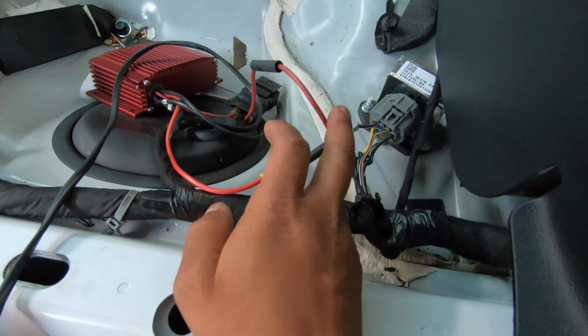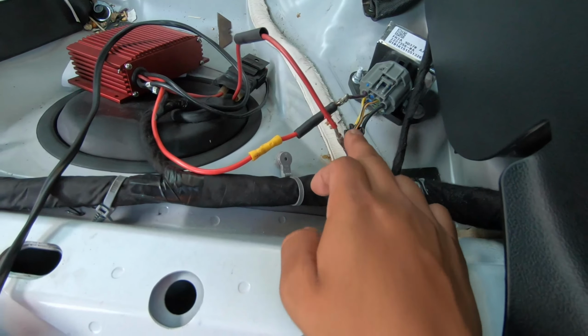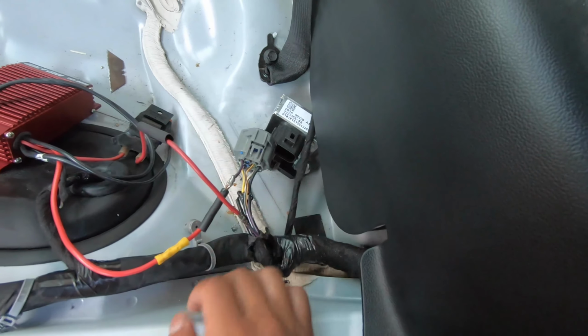And just like that, in a few moments, I have both all soldered up. I have this thing just covered up with nothing but solder just to ensure that it does not come off. So I put a crap load. So now it's time to move this heat shrink over it. I'm gonna heat it up to shrink it, of course, and then I'm gonna wrap it with electrical tape individually. And once I do individually, then I'm gonna wrap it all together just to make it look kind of clean, and then of course rehook it up. And yeah, that's my little method.